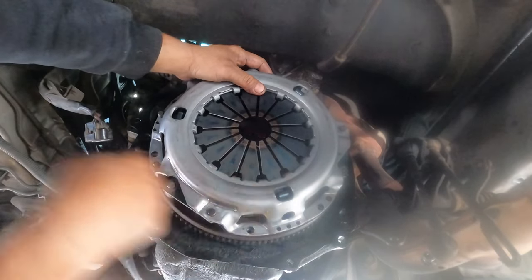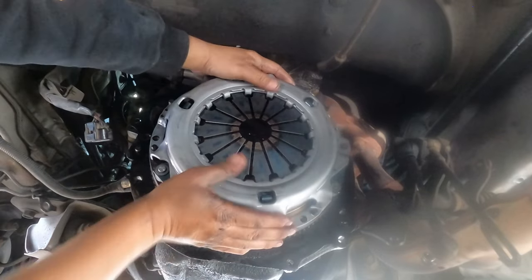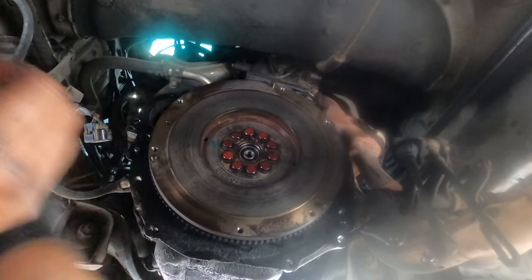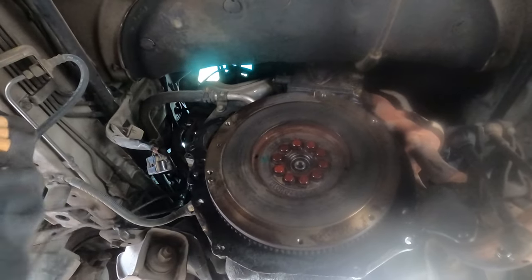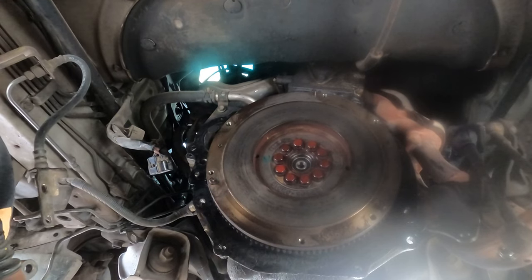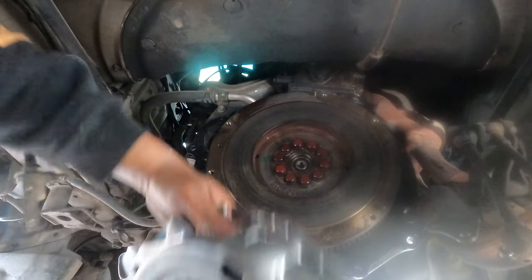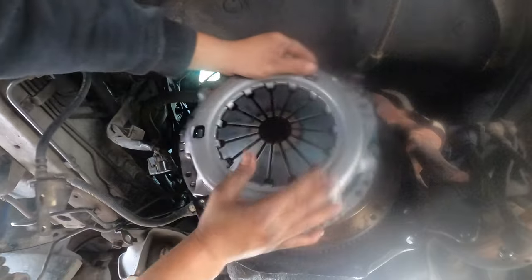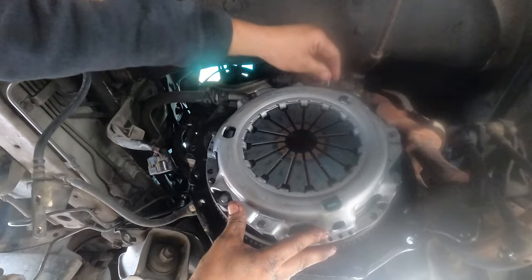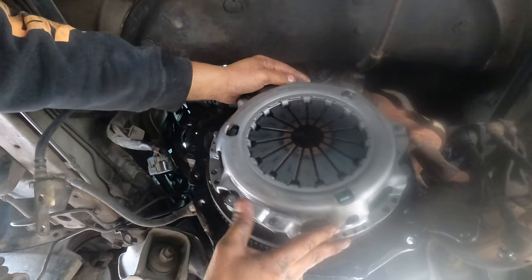It's gonna be in there, fit on the pin. You're gonna turn one pin up on the target and one pin right there. Just leave any pin right there, okay? All we have to do is pull it out. Take all the six bolts and nuts here and put a little bit of Loctite. I'll show you the trick so it's not too heavy when you lift up the clutch. Okay, all you do is lift it up, follow the mark, make sure all the pins are on the pins. So see this one, just put one top one right there, just one or two turns, that's it, and then you can pull backward like that and it's holding there for you.